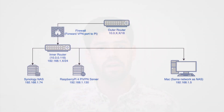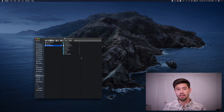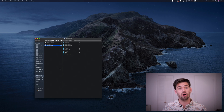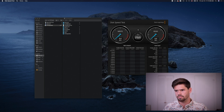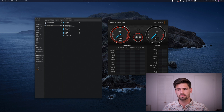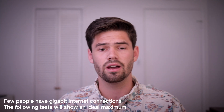For our control group, I have plugged my computer directly into the inner network, simulating your home network. I did not have to connect to the VPN because I'm on the network locally. We're using a Blackmagic speed test with a five gigabyte sequential read and write. As you can see, we're getting full true gigabit speeds, which makes sense — no bottlenecks from the drives or server side. This will also show how much a VPN can slow down your connection from a true gigabit baseline.